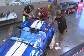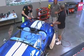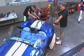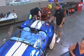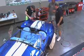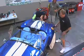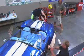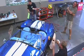And most of the time when these get out into the public and you got a bunch of detailers that have detailed them, the paint is always thin on all the high points of the fenders. So you got to be very careful of that, because you get some guy detailing cars with a compound and a wool pad sitting there, because it's so easy to just stand here and buff. It's harder to get down here and do the side of the door, see? So you don't have missing paint down here, just the high points.